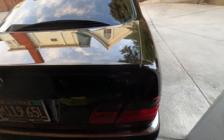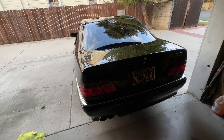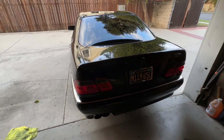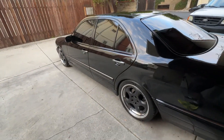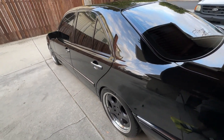This confuses a lot of people — they think 65 refers to the twin turbo V12 that Mercedes made, but that is not the case. This refers to the displacement. This is back when the numbers actually meant something on the back. 6.5 liters, rounded up from 6.4. So this is the 6.5 liter M119. Brabus redid the heads, the valving, the cams, the tuning, so this car really drives incredible.